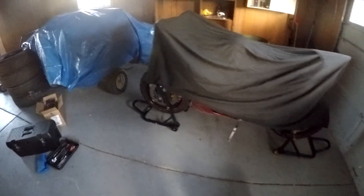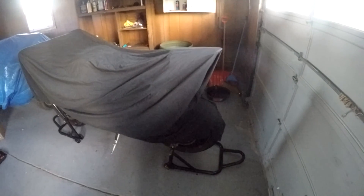That is exactly where it's going to sit until spring. Everything's done — oil's changed, gas is treated, battery's out of there, it's up on stands, I don't have to worry about my tires, everything's good. That is how you winterize a motorcycle.